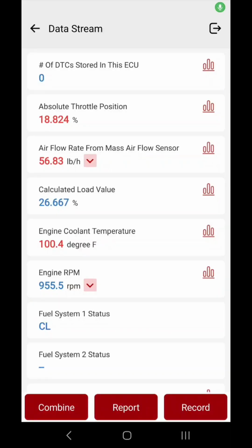Okay, so as you can see, the RPMs are down. I just put the old idle air control valve back in. So right now it's just warming up. But as you can see, it's where it kind of should be. I mean, right about now it would have revved up to almost like 1600, 1800 to 2000 RPM.